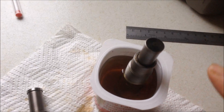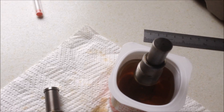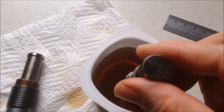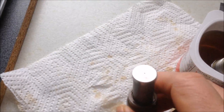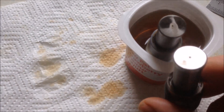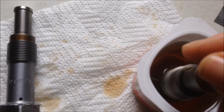Now I have some fully synthetic engine oil, and I put the piston into it, trying to fill some oil in to see the difference. Another thing you can notice is there's a small hole at the top — this is on the old design, and the new design also has a small hole there. I think it's a very similar size. So I try to get the air out through that hole.